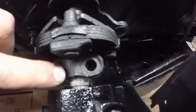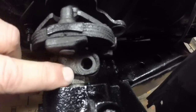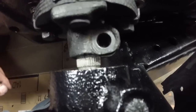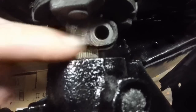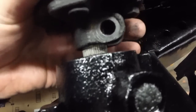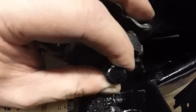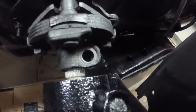There's a little notch right there on the steering coupler, and then there's a wider space between the splines. You line those up and this will slide onto the shaft. Then you've got to move it down the shaft — there's a cut groove in that shaft where the bolt goes through. The bolt won't go through until it's down enough, so I'm going to use a Phillips to pull that down.